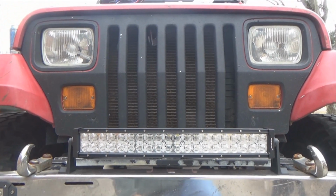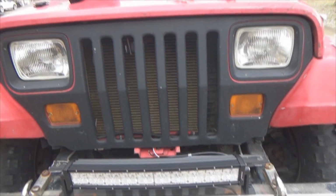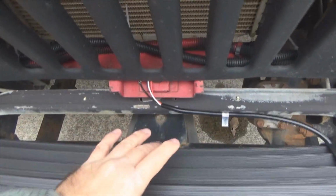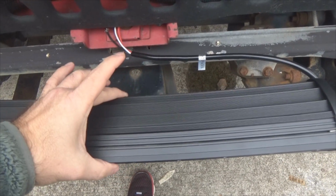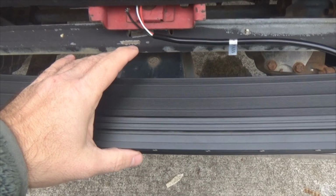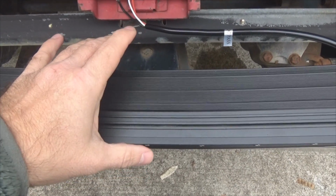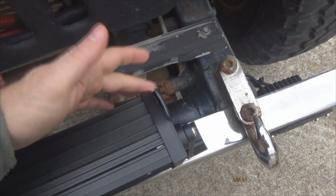Alright, I have the light bar set in place right now where I'm going to mount it. And notice also that this is the curved design. This actually alters your mounting depth some. If you're recessing this back inside of a plate, like if I was to fabricate a bumper, I have to accommodate the face being flush with the bumper, so if I was to drag upon a rock or something like that, I don't crunch the face of this. So this has to be recessed back, but then I've got to worry about this dimension.